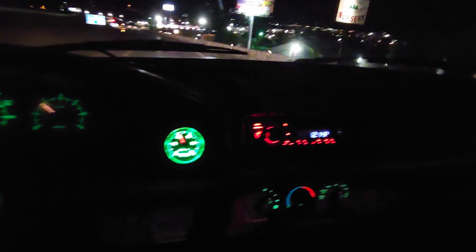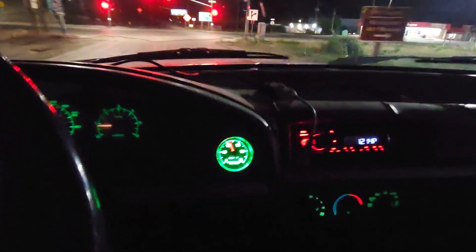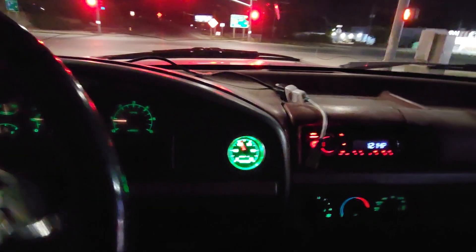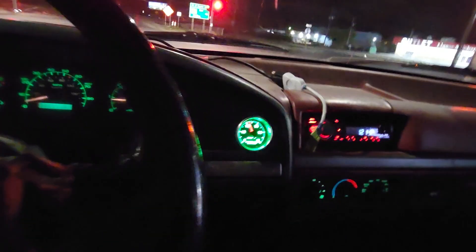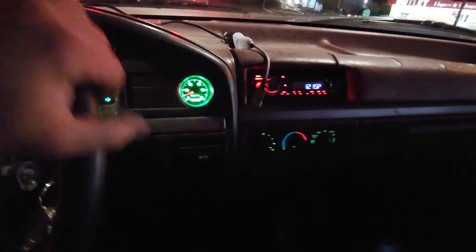I set the cruise a little bit on the fat side. I set the idle on the lean side because it doesn't matter — we can idle them at 18 if we really wanted. Notice no spluttering out, no nothing. I also think I shortened up the warm-up time. Air conditioning still works just fine, so I don't think that'll give you a problem either.